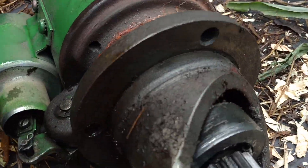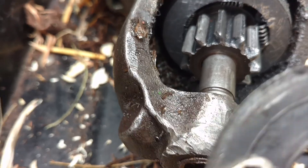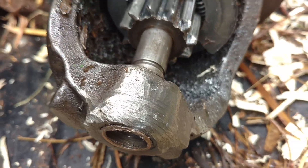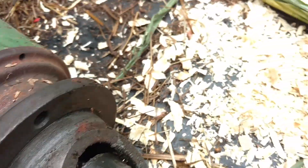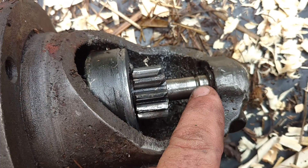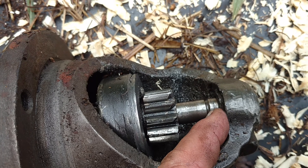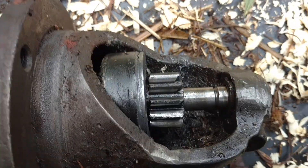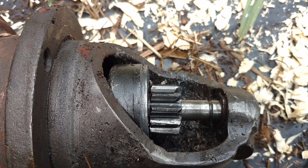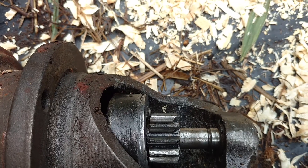This is why I had to take it out. You can see the guts of the drive hanging out. That thing used to sit in there and cover all that up. What tore it up is there's a groove right there, and there's supposed to be a little hardened wire snap ring — or tension clip — a hardened spring clip that looks like a metal lifesaver. It clips over that groove and they lock together, holding the drive from going out too far when the solenoid activates.